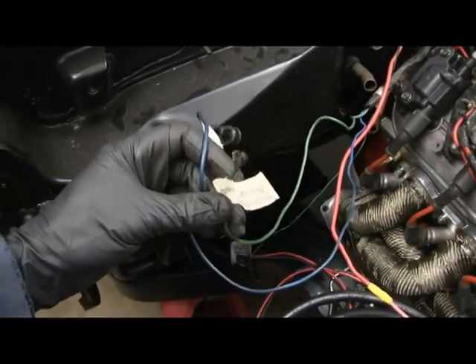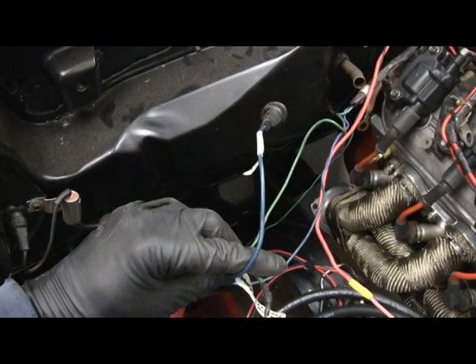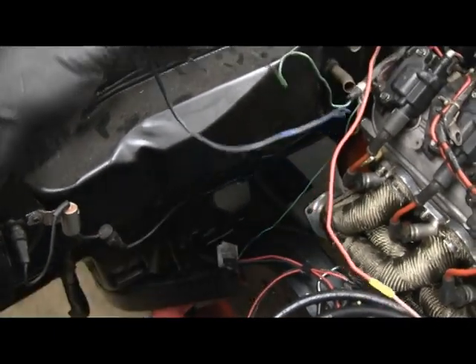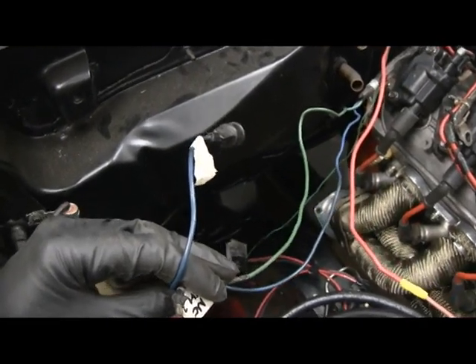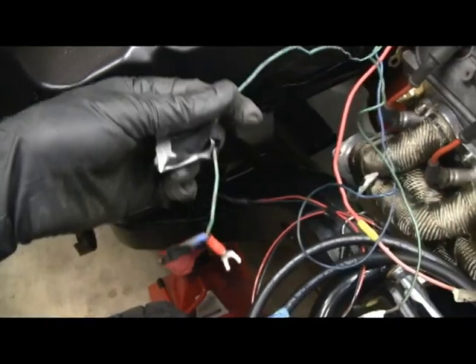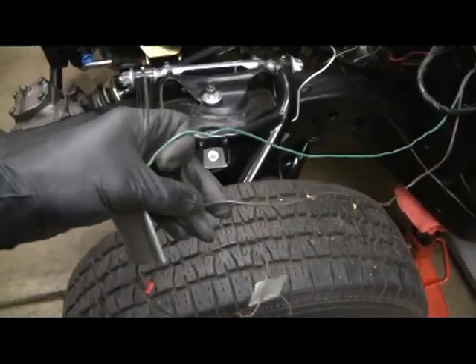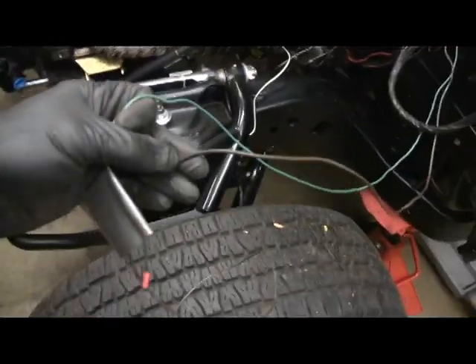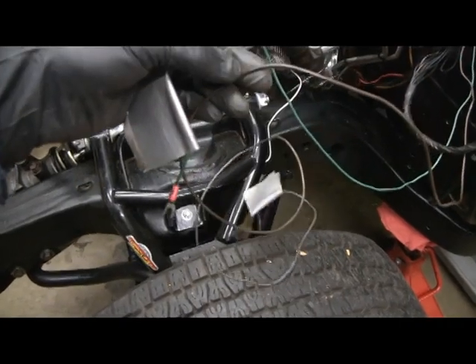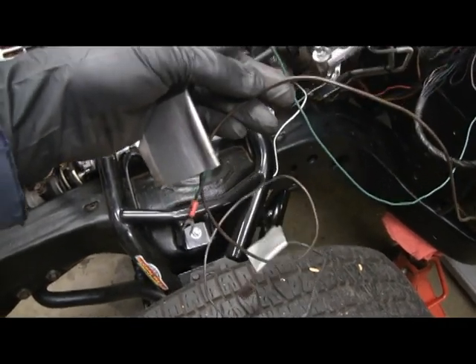I got the full 12 volts by hooking a wire up to the starter. The green is for temperature and the blue is for oil for the sending unit. These go to the gauges in the dash, which I don't use anymore, so I'll just wind these up and tie them back. This green wire here is to the auto meter gauge. On this side, the green wire is for the oil sending unit, which is right there behind the headers. And the brown is the tach lead — that will go to the tach module eventually when I get that hooked up.